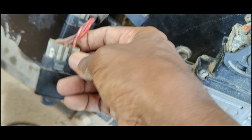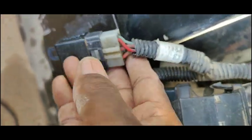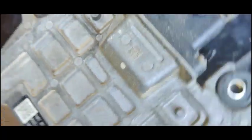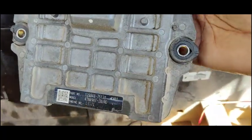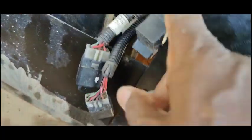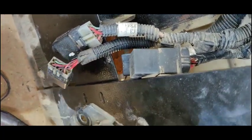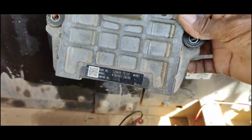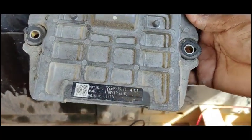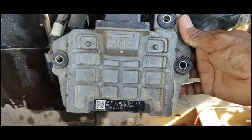Also, no power is going to the EGR, and no power is going back to the ECM through the ECM relay. When we switch on this machine, the ECM should give ground to all these relays — but ground is not coming. I concluded that maybe this ECM has the problem. I will try another ECM, fix it in, and then decide.